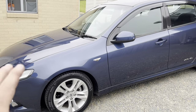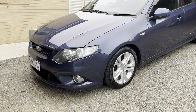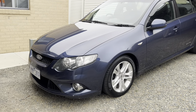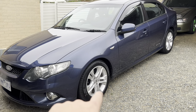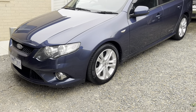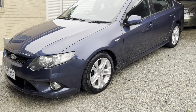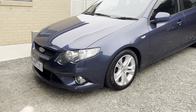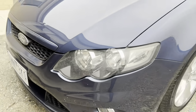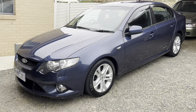As far as the list of things still to do on this car: we still need to put some front struts in it and new front bump stops. There's a slight play in the left-hand front wheel, which may be a wheel bearing — I need to look into that a little bit more. We've also got to put tyres on it and get a wheel alignment done with all the suspension work. I also want to do a headlight restoration as well because these are still looking a little bit dull.